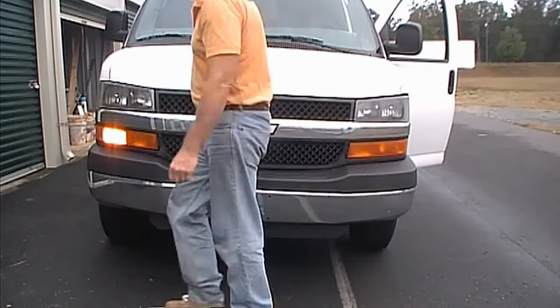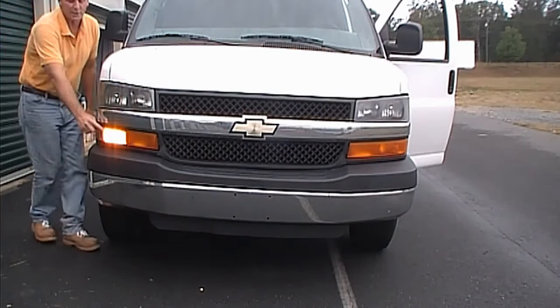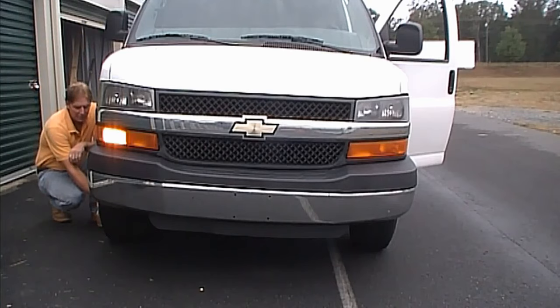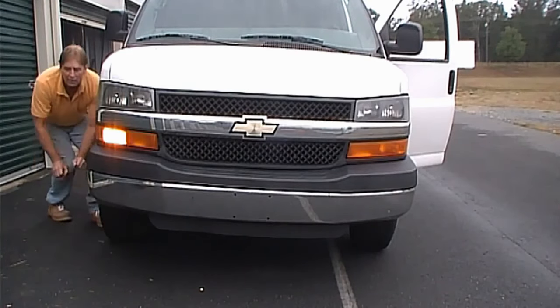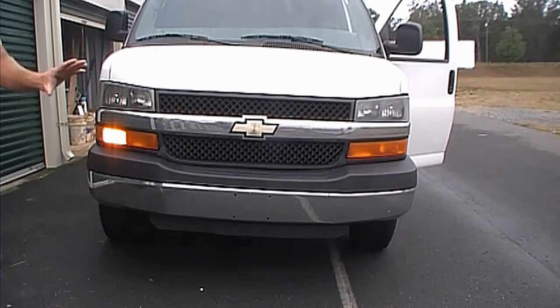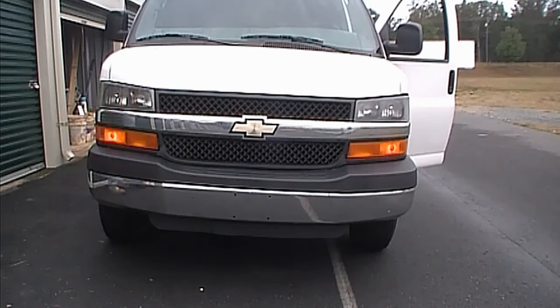There's our chirp. Moving on to the next one — notice that the passenger front light is lit, telling me it's going to learn this tire. Let the air out, only about five seconds, just long enough for the computer to notice that the tire is changing. Once it notices that, it will record and save it into the dash. We've got two tires saved.